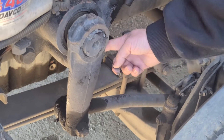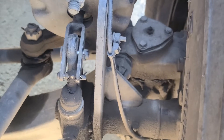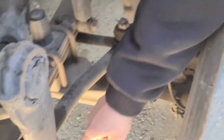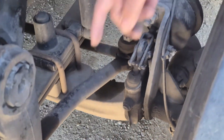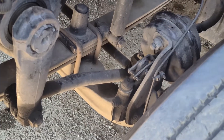Now I'm going to move on to my pitman arm, my drag link, upper and lower control arm, and my tie rod. They're not cracked, broken, or damaged. They're all securely mounted by three castle nuts and cotter pins, which are in the lock-tight position, and no missing hardware.